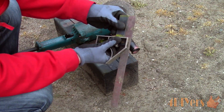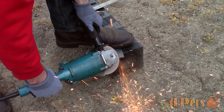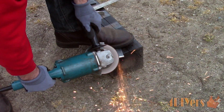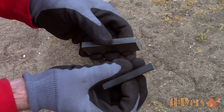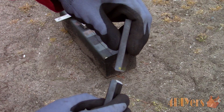I did double check to make sure everything was square and touched up the areas as needed. Considering this is a thicker material I am chamfering the edges that will be welded to ensure maximum penetration — if there is minimal penetration this can create a weak point that can fail. Beyond that, this also allows the welded areas to remain slightly sunk so minimal grinding is required. Excessive grinding of a weld can also jeopardize the structure and strength.